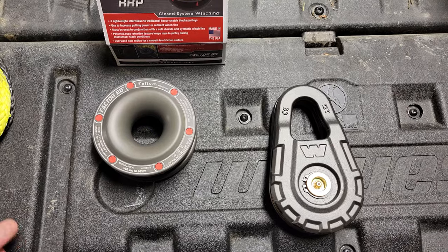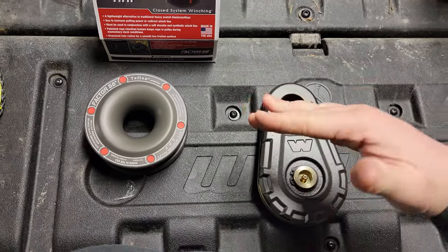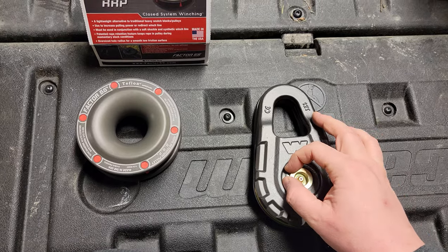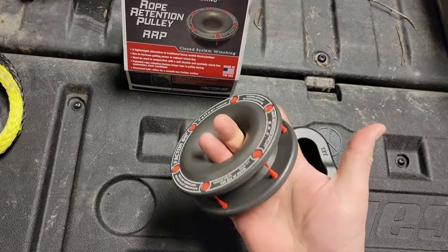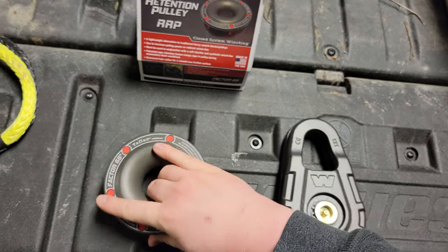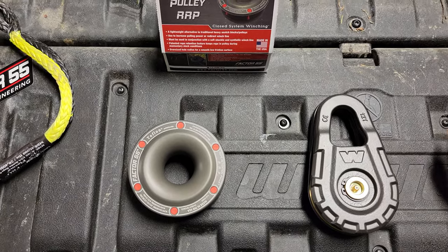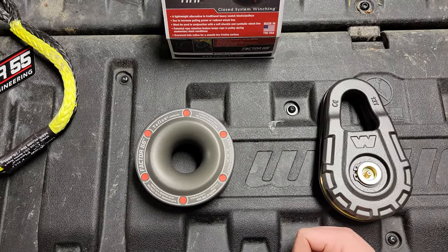The snatch block has sideward tension somehow, which can put pressure on the snap ring and snap it. So if it's not an ideal pull it could damage the ring. I don't know if it was just not seated correctly. Either way, I'd like to see a snap ring tool with this thing. That's a 15-minute video saying the same thing probably a hundred times. If you guys want to like and subscribe, cool. Have a good morning and we'll see you guys on the trail.